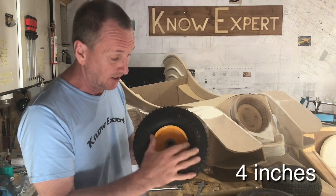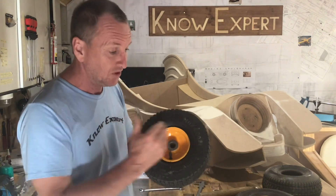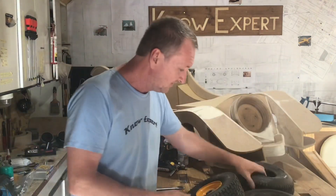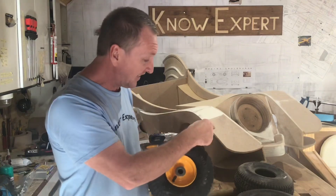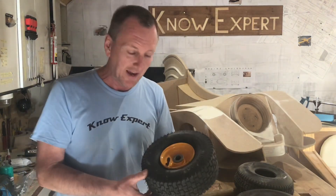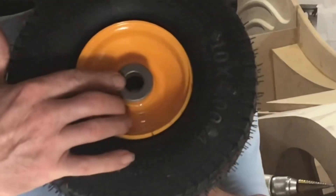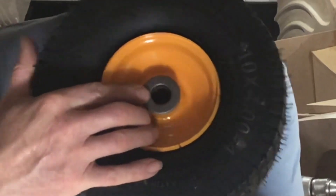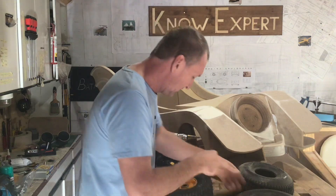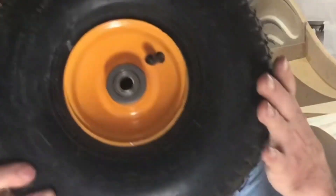The diameter of the actual rim — what I wanted was an 11, so I ordered an 11 so that I could put that tyre onto this rim. Now when they arrived I thought they had bearings in, but they don't have bearings — they have a bush. So what I've got to do is knock the bush out, drill, and then I can fit the bearing like this.